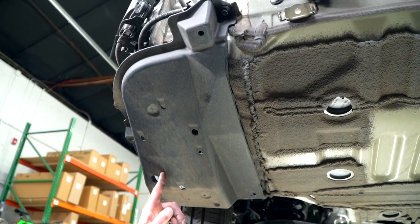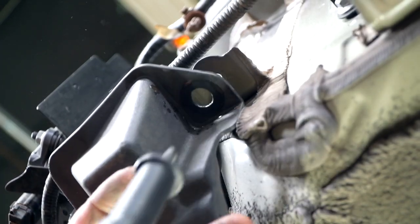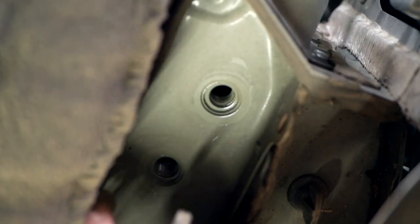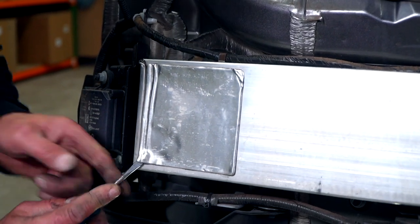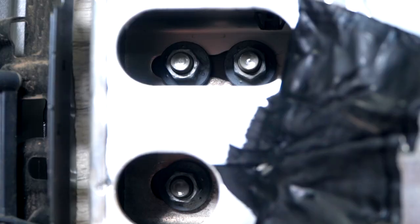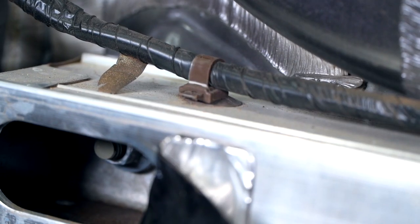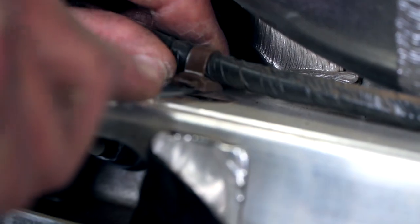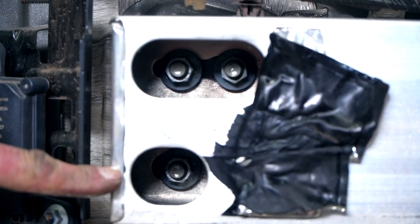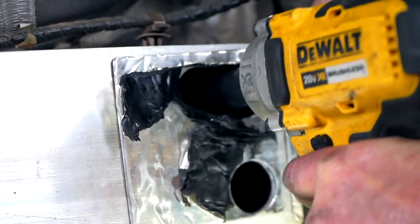Next, we're going to remove this panel on the driver's side — it has three bolts and we're going to use a 10-millimeter socket to remove them. Next, we're going to remove the two rearmost plugs on each side using a flat blade screwdriver. Next, using a flathead screwdriver, we're going to remove the tape from the bumper beam — just peel it back so you can get to the nuts inside. Repeat the same process on the opposite side. Next, we're going to remove the harness from the bumper beam; there's an attachment point on each side. Next, we're going to remove three nuts on each side using a 14-millimeter socket. Be sure to set the nuts aside for later use. Now we're going to repeat that on the passenger side.